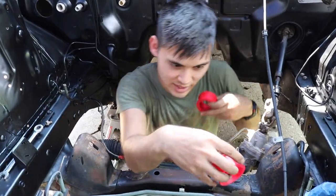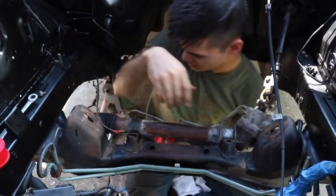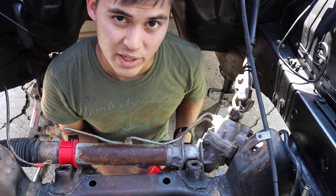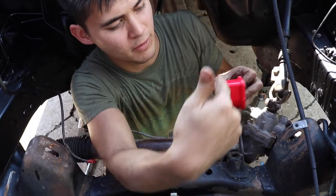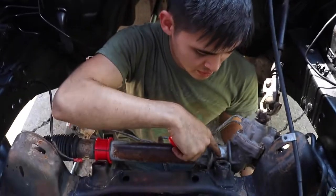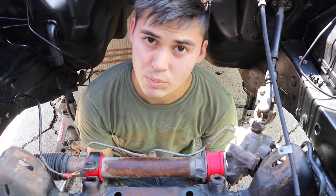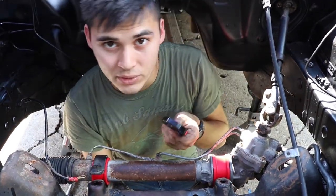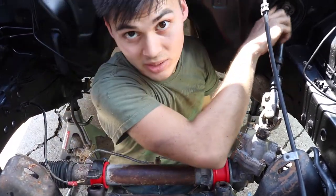It turns out there is a difference between these - one is bigger than the other. It looks like the best approach is to orientate this so that the gap is facing towards the firewall, because there's more metal on that side where the bushing is going to be contacting. Now the last thing is to bolt this all up, which is the same process in reverse. While I'm at it, I'm also going to install the solid steering rack bushing which is going to go right where the steering column meets the firewall.